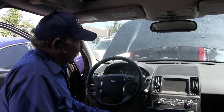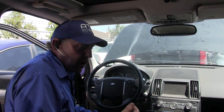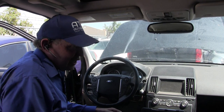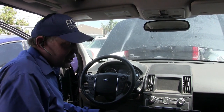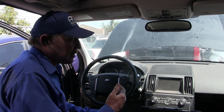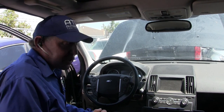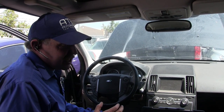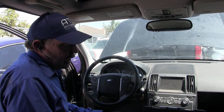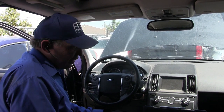I don't know anything about this car, so we're going to apply a strategy like I do on all of these systems. Don't let the data when you come to a shop sway you. We're going to go through a set order in a prioritized manner so I know I can find this quickly and efficiently — and that's going to be by finding the easiest computers I can get unplugged while we watch the bus.